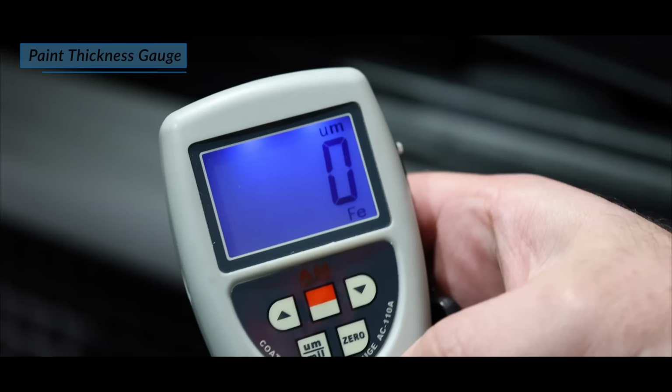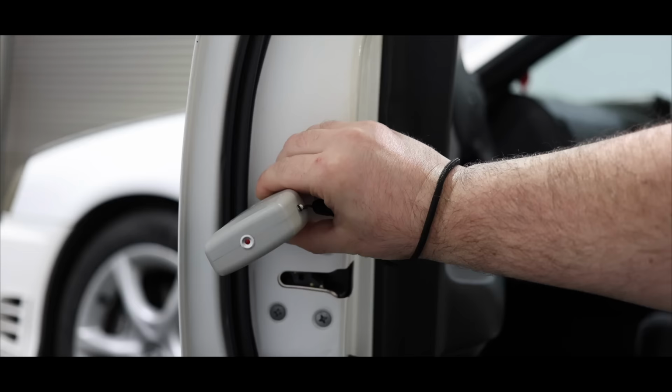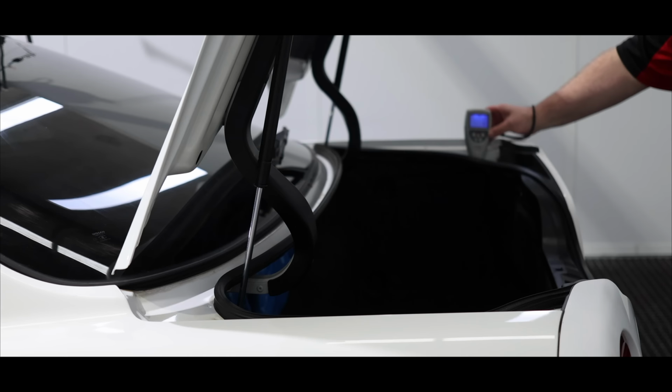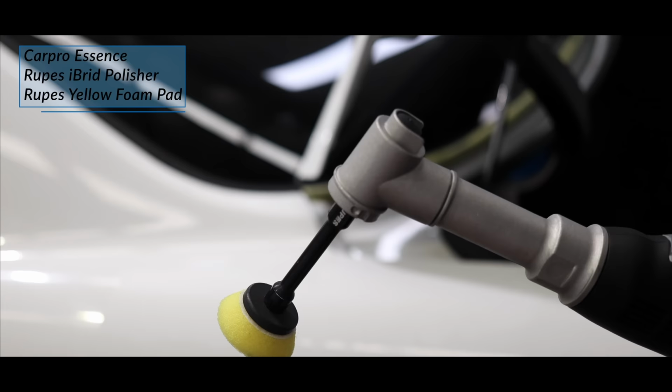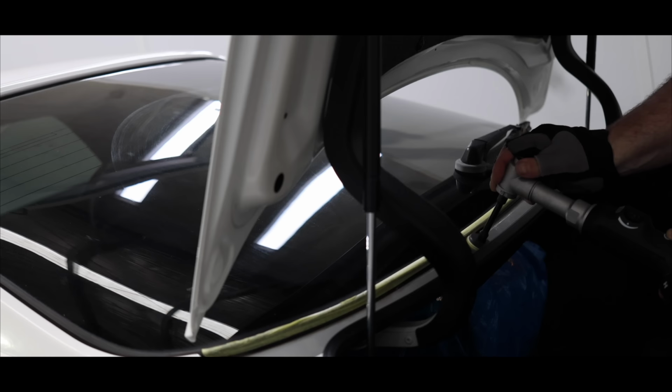As I've mentioned in the past, door jams typically have very little paint or clear coat applied. So correcting them like you would car paint is generally off the table. But a super light polish with a non-aggressive pad will be safe and will help restore some gloss and clarity, and even more so, further help deep clean them to remove some staining or blemishes that cleaning chemicals alone can't always remove.